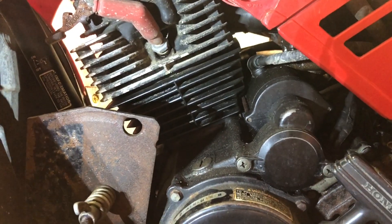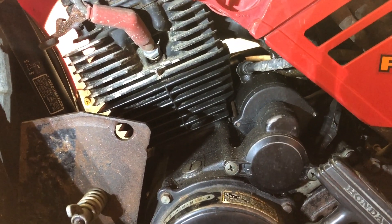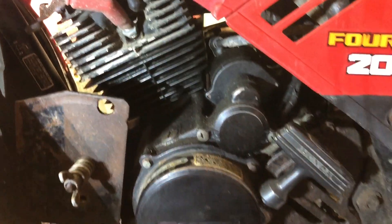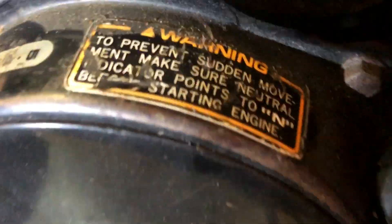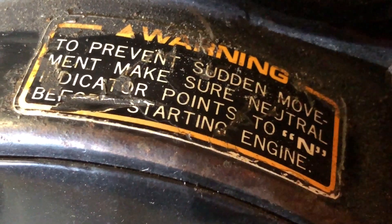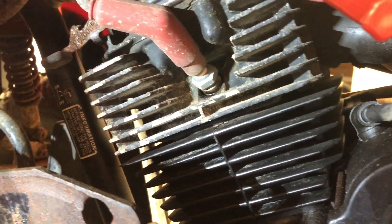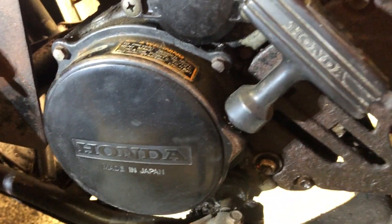Because of the rocker-box design and fewer moving parts, and given that 80% of your power comes from the cylinder head, I have a feeling this thing is quite a monster of a little machine. That's to be expected with an 8,750 RPM redline — quite a bit for a little old ATV. Just look at the head design; the lines on this head make it a really neat-looking engine, better-looking than some modern engines.